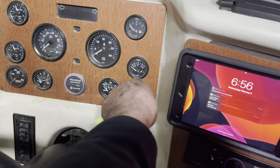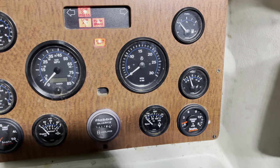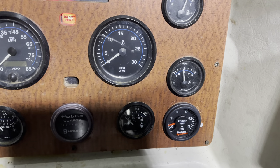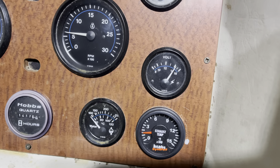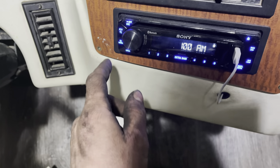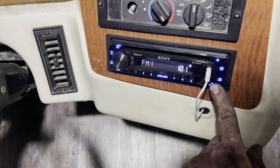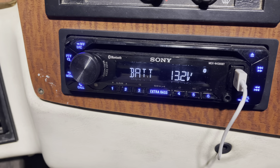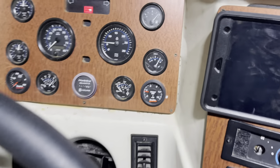Here is our voltage gauge — we're just going to keep an eye on that. It's just under 12 volts with the key on and engine off, which is about right. Oh, much better — look at that. Now we're charging. This radio also has a voltage reading. If I hit display, there's our battery voltage. I found this radio reads about one volt lower than actual, so that means we're at about 14.2 volts, which is perfect — right where we need to be.